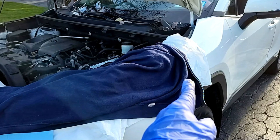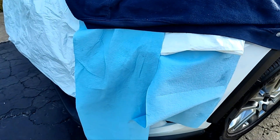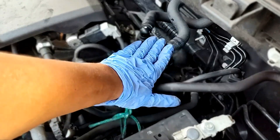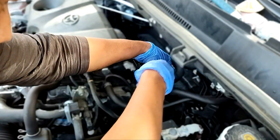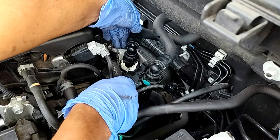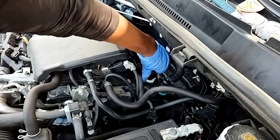I have just put up some pieces of clothes and bags right there, and some racks. I have tightened these hoses here so the camera can have better visibility. Disconnect the electrical connector by pressing the tab and pulling it out. Now, before pulling out the hose, make sure you have a bucket on the floor to catch any antifreeze that is going to come out.